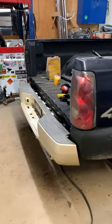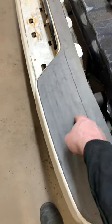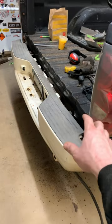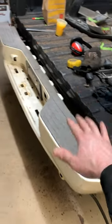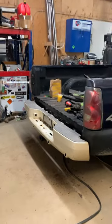I came into work early this morning and got at the bumper. I had to cut all the little notches where this bumper pad sits down on, because this is a Chevy truck steel bumper with an Escalade plastic bumper cover, and I didn't realize that the steel bumpers were going to be different. So I got them all cut in with the plasma cutter and snap snap snap snap, it all sits in place and it looks so good.